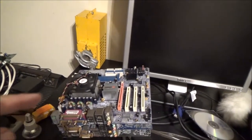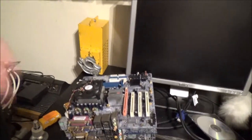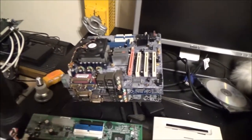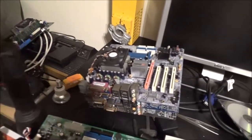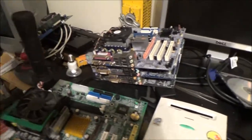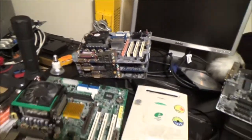When I initially tried these motherboards, they didn't even power on. But I found that changing the BIOS battery — which was dead as a doornail on all of them — and then plugging in the video card and RAM, they powered straight up, all three of them. I actually couldn't believe it, to be honest.